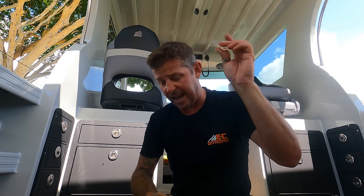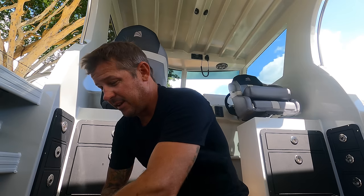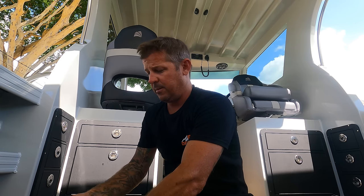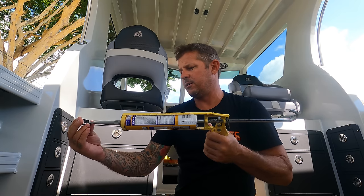He didn't get something quite right on the electrical system. When I turned the house isolator off, it wasn't actually turning the house off all the time. And it turned out that the DC out circuit breaker was run incorrectly. So he drove an hour and a half out here, fixed everything up, no questions asked. He's just a good bloke. And it's been really refreshing to deal with someone who knows what they're talking about and actually gives a crap. So I can't speak highly enough of how he's been so far.